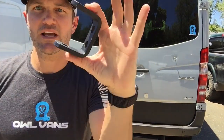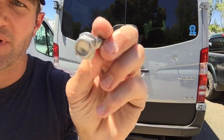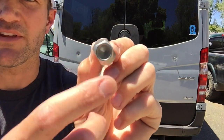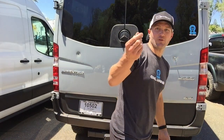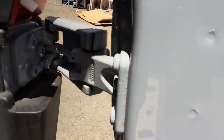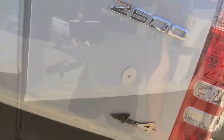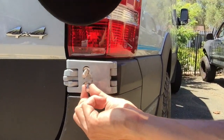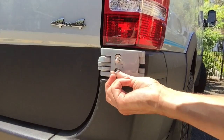Now it's time to install the hinges — they kind of look like Cs with holes in the back. There should be four bolts: three of them look the same, and one of them is narrower. That's because the bottom hole requires a narrower bolt. Go ahead and take these bolts and stick them in — that bottom one sets in there like that. When you install these bolts, make sure the bolt is moved all the way towards the side of the vehicle, because there's a little catch in there that can impact the top of the bolt. So once it's over here, you'll see that it's loose — that's good.